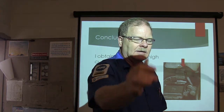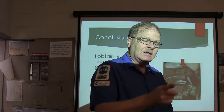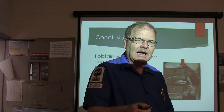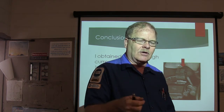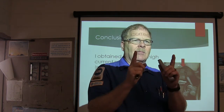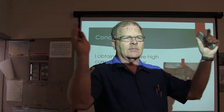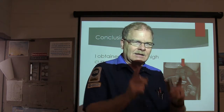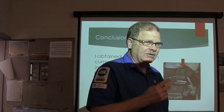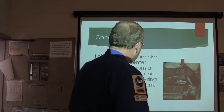We put an ignition switch on a little Ford Ranger one time, and there's a ground that's feeding the ignition switch so that it can test out the brake light. And that ignition switch was shorted internally, and when we turned on the key, it burned a little ground wire about that long. It's coming from the ignition switch connector over, and it filled the cab up with smoke on that truck, and you'd think you'll have to put a whole new wire harness in it. Just that one little wire. Now that's poison smoke too, so you don't need to breathe in that. It ain't near as much fun as smoking cigarettes.